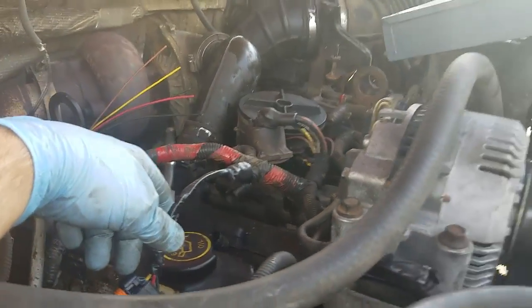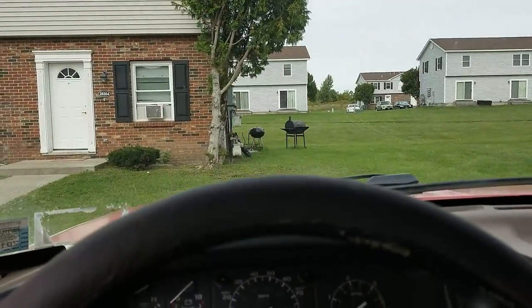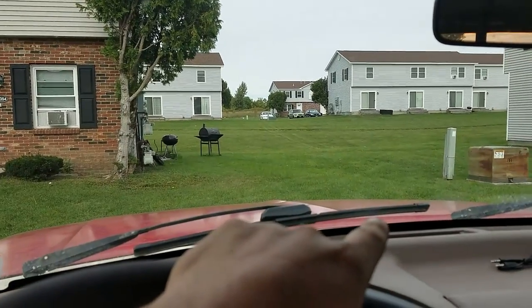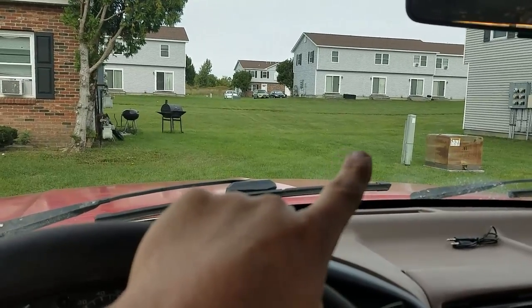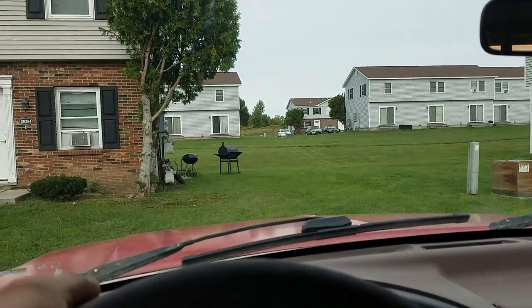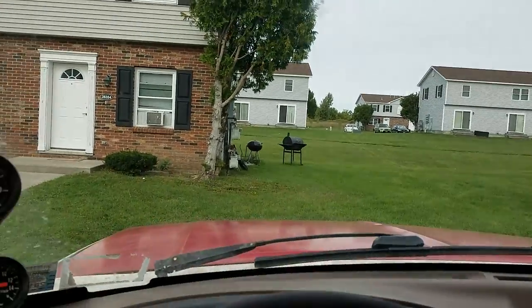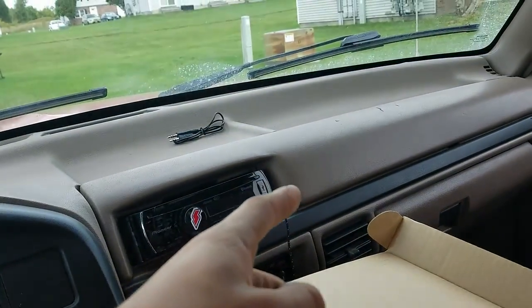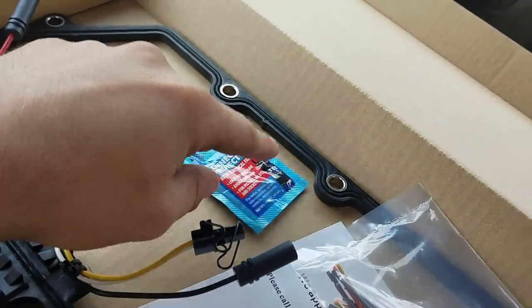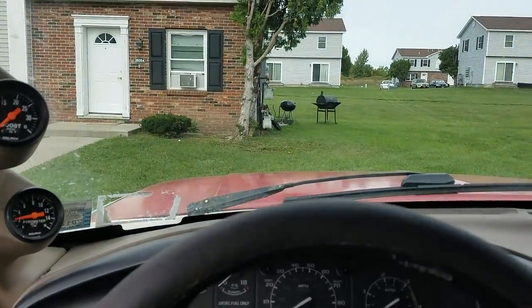Just got one more to do and we'll fire it up and see how she sounds. Fairly sure that was the problem. So I went ahead and replaced the two connectors on the passenger side and it didn't fix the problem, even though those connectors were, as you saw, shot. So we're going to go ahead and go over to this side, replace the two connectors on that side. If that doesn't work, I'm going to rip the valve cover off and put a new gasket on. I'm also putting dielectric grease in these fittings to lock out the moisture so I don't have to do this again.